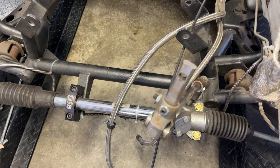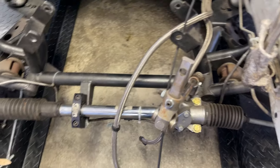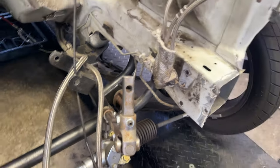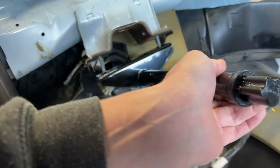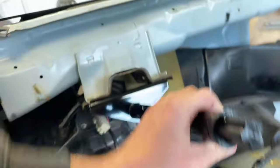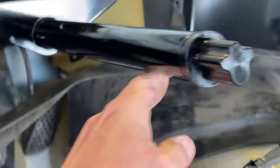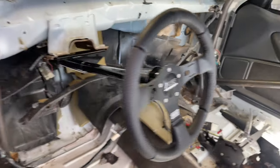I also picked up an MPI steering wheel from them. So we got all sorts of new stuff going in the Camaro. I already messed up - I thought the adapter from the old column would work on the new column because I already adapted it to manual steering, but it's not. Instead of a DD shaft I actually need three-quarter round. Ididit columns are super easy to install - slide it down through there, bring it up into the same spot, grab the little nuts, bolt it down, put the bolts in the firewall, and we're back to having a column in the car.